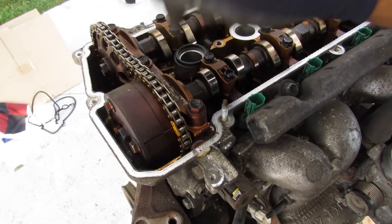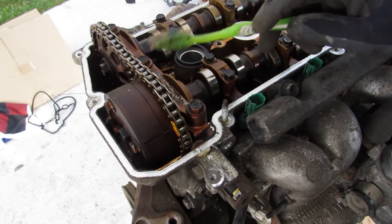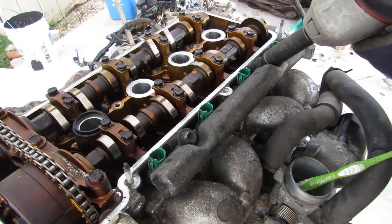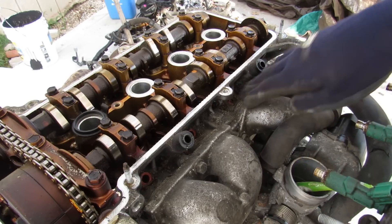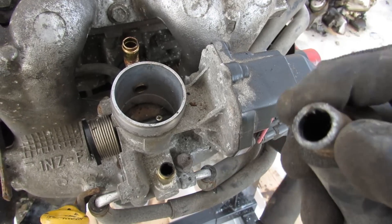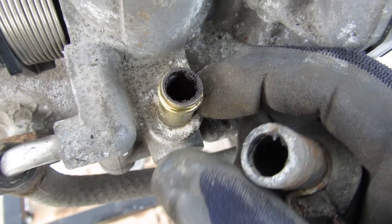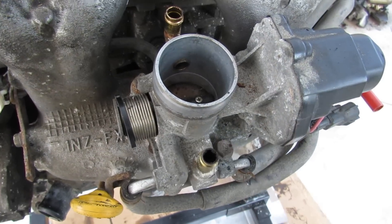There's a bit of looseness in the gasket but that seems normal. You've got the exhaust camshaft at the back and the intake camshaft up front. The intake has a big gear for variable valve timing powered by a solenoid. Removing the 12mm bolts on the fuel rail, these are the port injectors that inject fuel into the air stream. Looking at the PCV hose connection, it's full of crust inside — that's what the PCV system deposits into your throttle body over time, building up a lot of carbon.